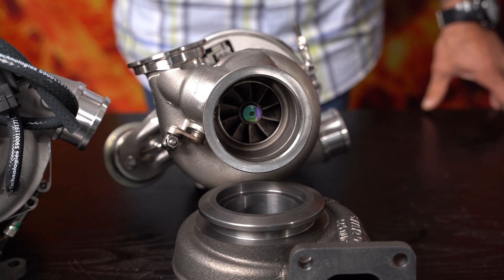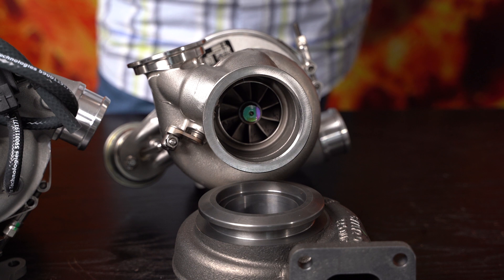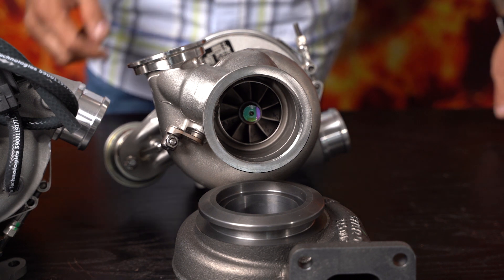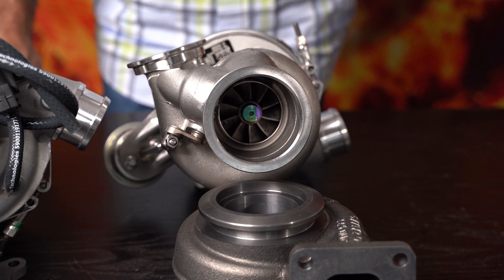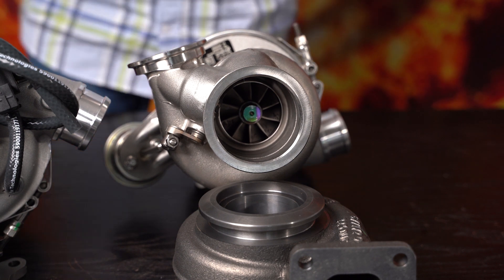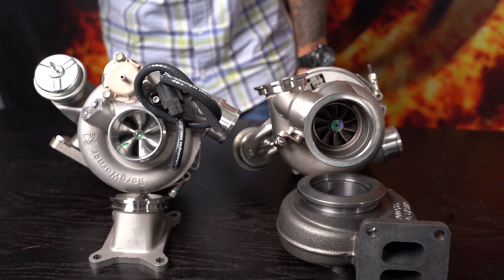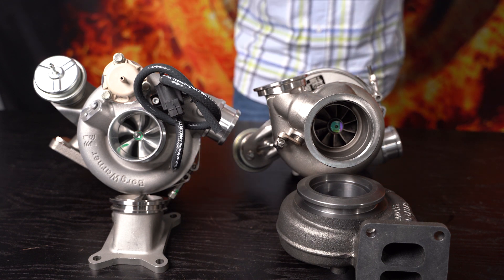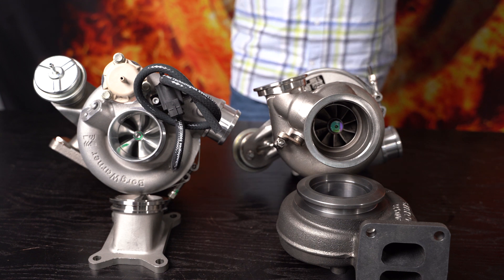There is another video on our YouTube channel comparing the weight of a genuine Garrett GT30 and GTX30 turbine wheel next to the EFR 7163 — the 7163 is approximately 35 percent lighter. However, the wheel is one mil larger on the exducer and three mils larger on the inducer than the Garrett. Size for size, this is equivalent to a GT/GTX30 family turbocharger — but the difference is these are internally wastegated, include diverter valves and boost control solenoids. When purchasing one of these turbos, keep in mind you're getting a lot more than an externally gated product that requires a separate external wastegate and blow-off valve.